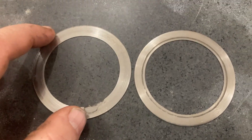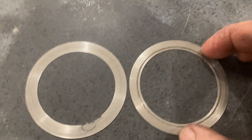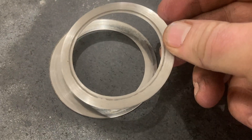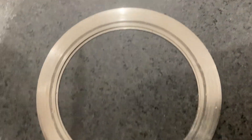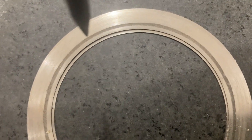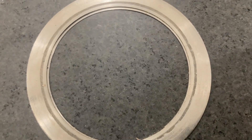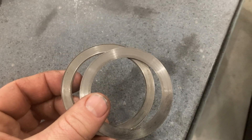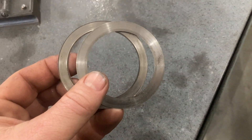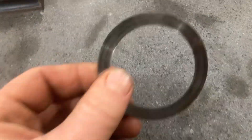On the left is a 1600 end play shim and on the right is a 40 horse end play shim. These are different sizes, and you can see just looking at them that they're different. If I put the 40 horse on top of the 1600 shim and line it up, you can see that the 1600 shim is smaller on the ID than the 40 horse shim. So what would happen if you tried to put the 1600 shim on a 40 horse crank is you can force it up over the crank, but it's going to roll that inner part of the ID up around the crank and it's going to end up jamming and destroying the engine.